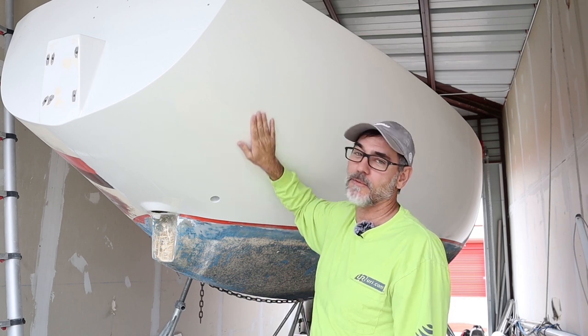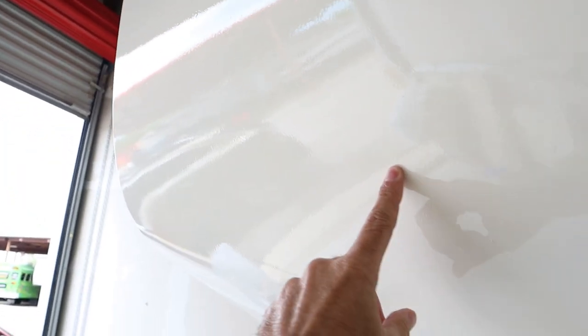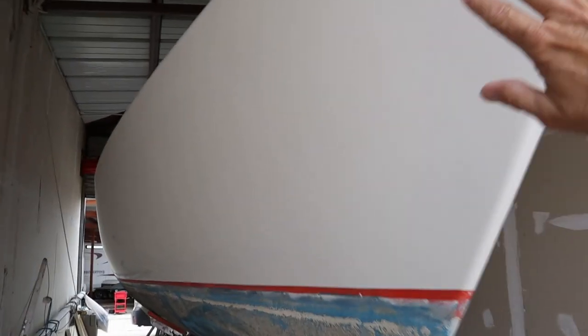You can see some orange peel here. I spent a lot of time on this and in order for all that time to pay off, I really want to get it just like a piece of glass — very, very smooth. I'm going to start the sanding process using 320-grit sandpaper hook and loop, really go over this and get it as flat and smooth as possible. That'll get rid of any orange peel and then I'll continue on.